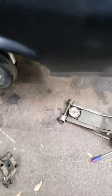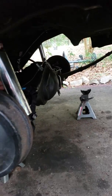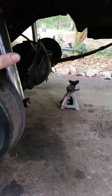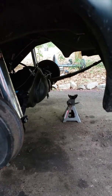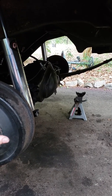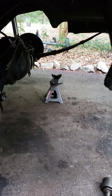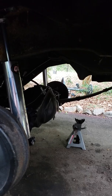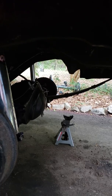Oh yeah, and this thing has a Ford 9-inch under it. So this Ford 9-inch is actually longer than the rear end that comes in these Novas. So I'm using a 3-inch back spacing with my rims to center it in here. And I haven't even rolled anything. Nothing's been rolled yet, so I still have that to do, which will gain me some more clearance. But I'm gonna make this happen one way or another.